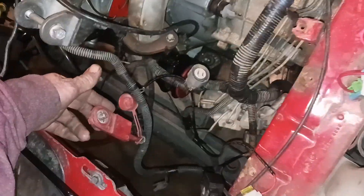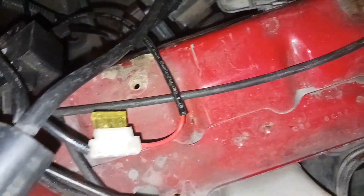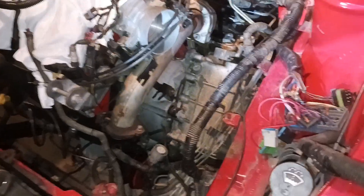I've got to make sure this is a power wire for my headlights. It's coming along great. I've got the positive cable hooked up here and the ground is here. So both of these will reach right over here where the battery tray bolts, because the battery tray bolts in right there on those two. The battery tray sits here and I've got the brand new battery right there and the old junk one right next to it. So that brand new battery can go in here and then the car will have power. Technically I should be able to at least turn it over.